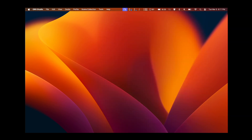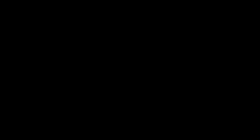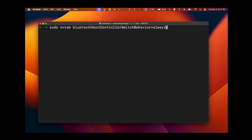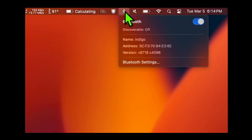Then close the window. Before you reboot, click Option then Bluetooth and make a note of the address of the controller — usually the last two numbers will change, so just remember those. Mine's 3C. Now in a terminal, type this command: sudo nvram Bluetooth host controller switch behavior equals always. That's like setting the BIOS, the non-volatile RAM — it means that when a Bluetooth dongle is plugged in, it will take precedence over the built-in.